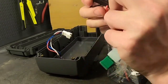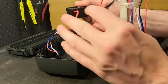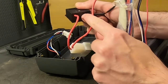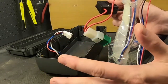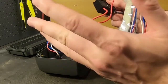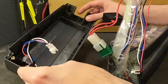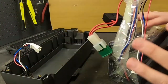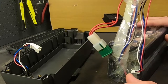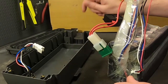There is another version of this battery pack where they actually have 4 pins available. One of the packs has a red wire added over here, but it's not used for anything I can tell. It might be a smart battery pack used for signaling of some kind. But in every single time I've worked with these battery packs, I've been able to change the BMS and everything on the inside and it still works — except you have to change the charger. So don't worry about the discharging port; it will be fine even if it has some extra red wire.